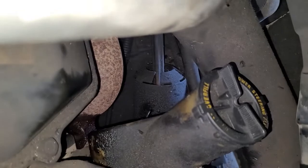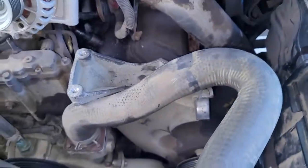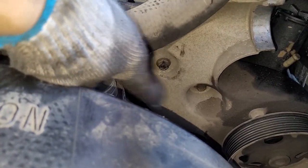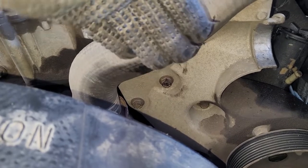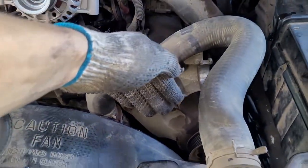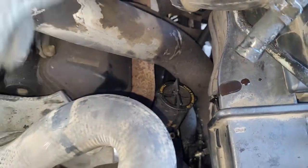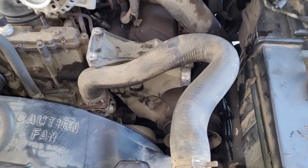That fitting is off. You have one more — you can just see the edge of the hose clamp on top. I'm going to remove this whole bracket. There are three 13-millimeter bolts, and once you take those off, this whole assembly will slide out this way, giving me more room to reach down and take off the last bottom hose.